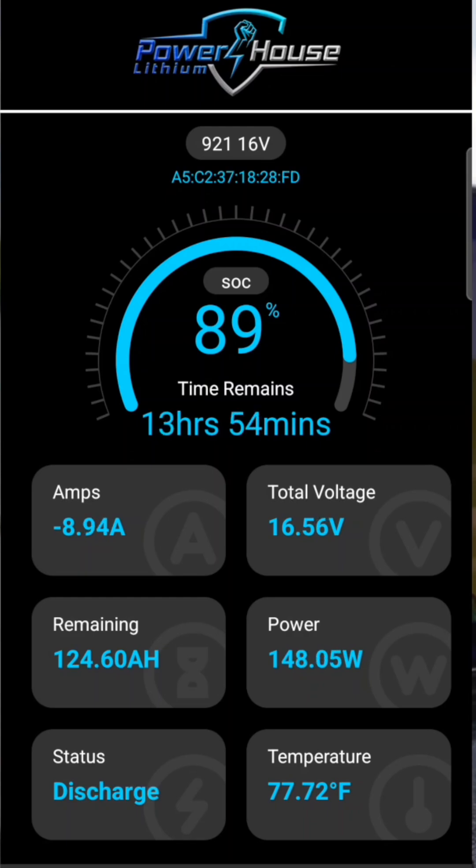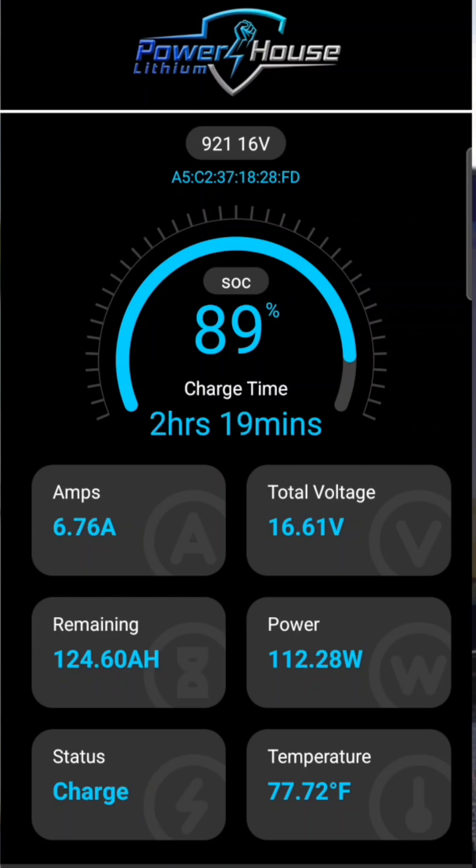What this DC charger is going to do is when I kick this motor on, it's actually going to send energy to this battery and start charging it, and you'll see those amps change from negative to positive. So I'm going to go ahead and crank the engine. And automatically, just at crank, our amps are now up to 6.8 positive amps of charging and our status on the battery has now changed to charge.